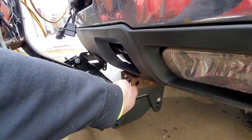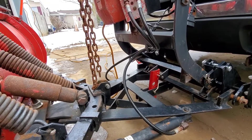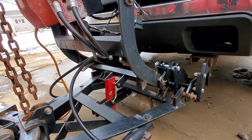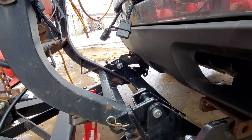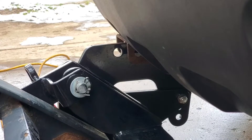If you look, I'm not all the way in yet. Also, if you use the factory Unimount foot — which you're gonna have to do anyway to keep the mast here upright — it actually sets the plow down pretty low. I have blocks of wood underneath the snowshoes. Because the front of my truck is kind of low too, I have a scissor jack here that I'll put underneath the beam in the middle. As I lift it up, you'll notice it changes the angle, which is perfect — that's what we want.